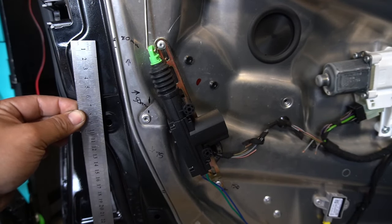When mounting your bracket, there is a curve in the door panel so the bottom bracket does not sit completely flush. What I did was line up the bracket, mark a line where the curve is, and bend it there. I simply bent it back out and made sure I could get a rivet in. You can do this with a pair of pliers — once you pop rivet it in, it will bend and line up anyway. Just get it as close to the door panel as possible so it grips and sits flush.